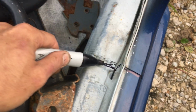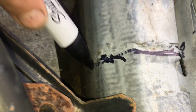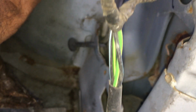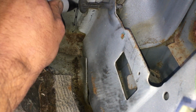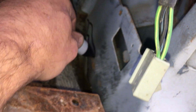So being that we're going convertible shouldn't be an issue, but I can come right down along these two factory lip lines here. And as I follow this bracket, basically we just continue out until I meet the wheel housing that I was showing from the front view. So I need my cowl panel, but should be able to come into the wheel housing here. And then somewhere in this bracket area, you can tell me if you want me to save this bracket and come down here to give it to you, or I would probably just try and cut as easily for myself as possible. Maybe come kind of through this area just to meet up below this thick metal bracket here. So something to this effect is kind of what I thought you'd need.